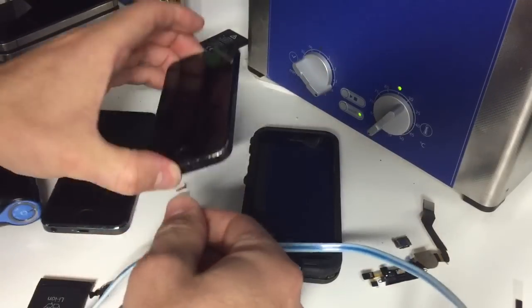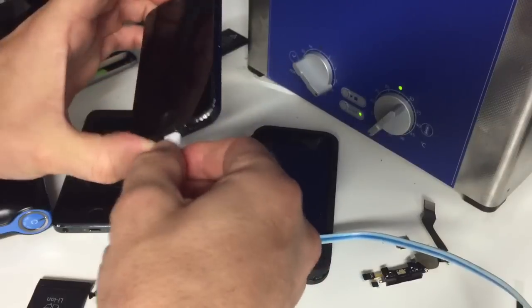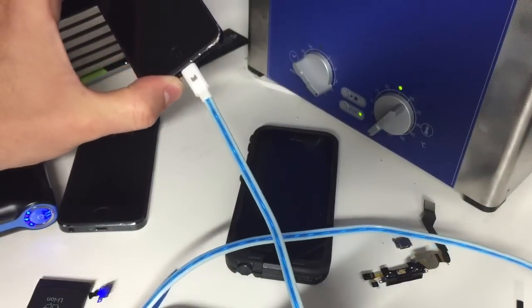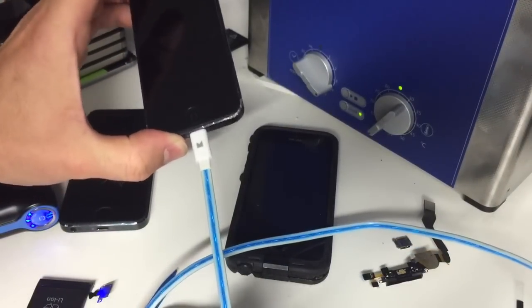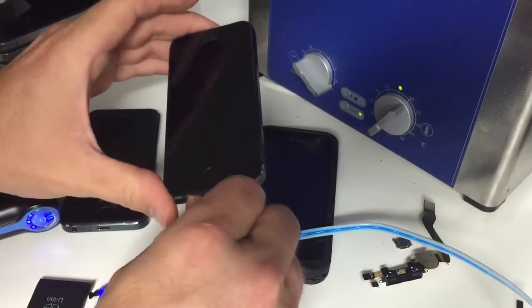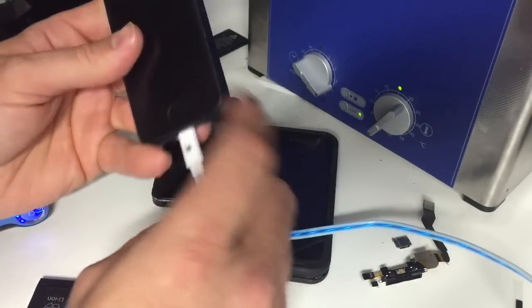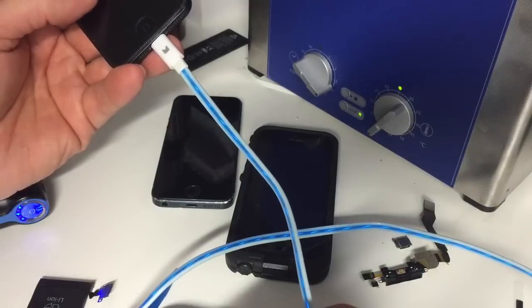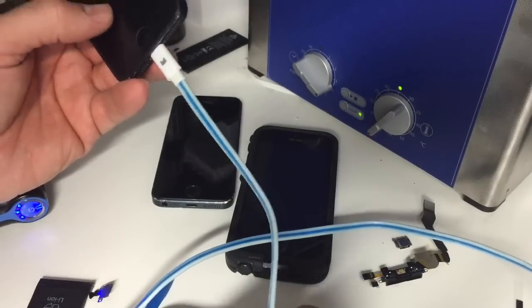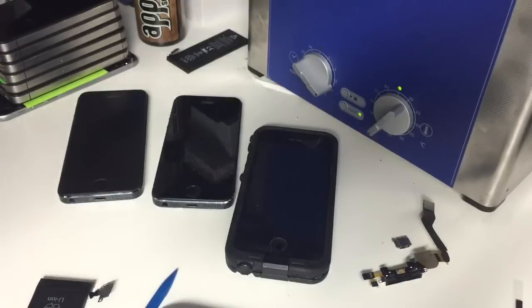Aside from that, the main point of this video is to show you this cord - it's one of the cheapest methods for diagnosing a battery problem there is. On this phone, it's water damaged, it's dead, it's been cleaned, the charging circuit is working, and the battery is charging, so now I need to figure out why it's not powering on. On this other phone, same thing - water damaged and dead - but you can clearly see the charging circuit is not working. I like this cord for that reason. I'll talk more about the charging circuit and further diagnosis and repair in another video. Thanks for watching - this is Trent with RicesForDinner.com.